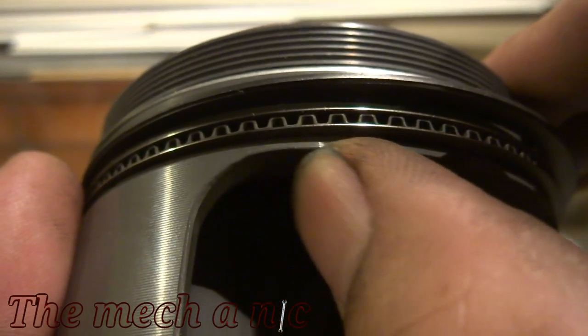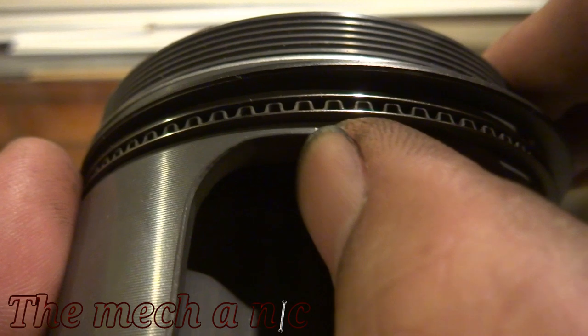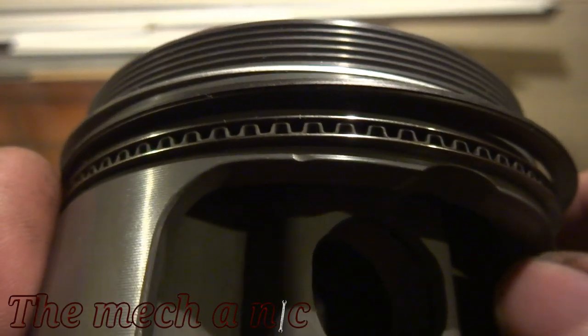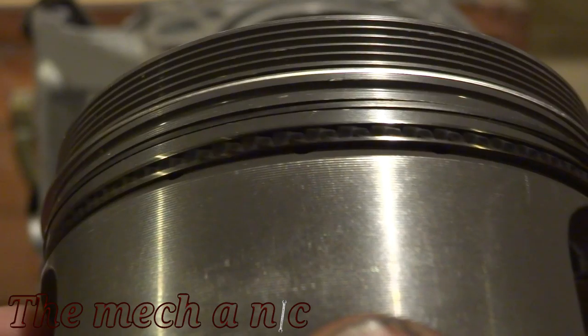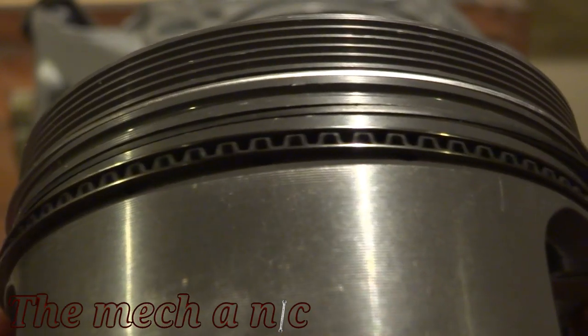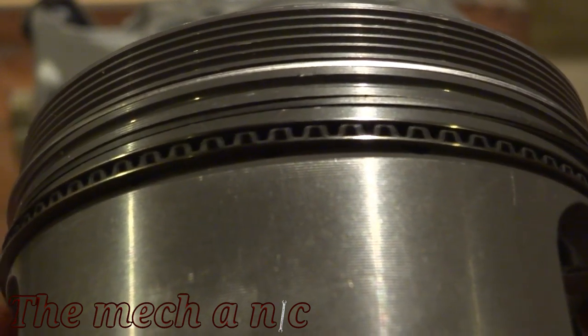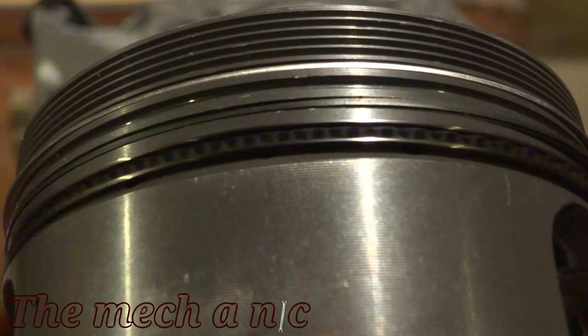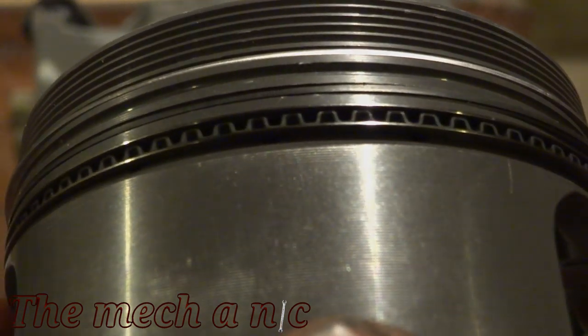But there was a similar one, like I said, right in the channel where the oil control rings go, and it would not let the rings move freely. Took everything back apart. I raided my daughter's nail collection, and I found a really small file, and I was able to just file away that little burr, and now you can see how the rings move freely. So just really keep an eye out for that.